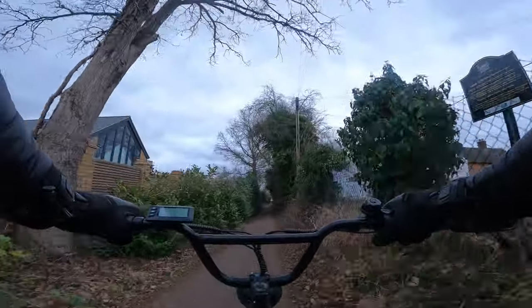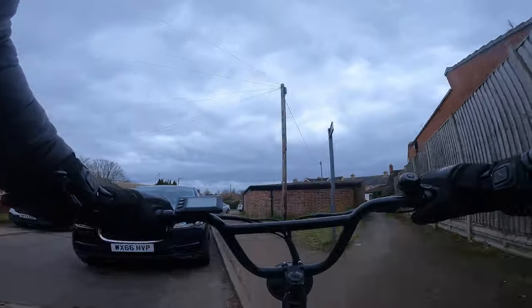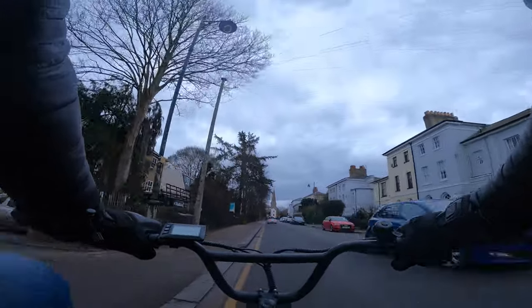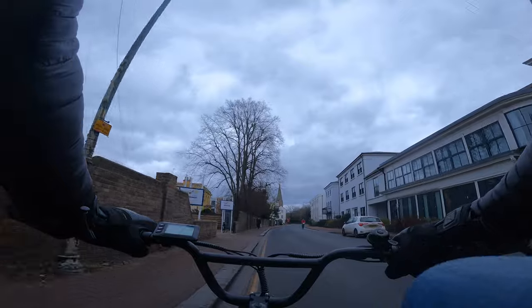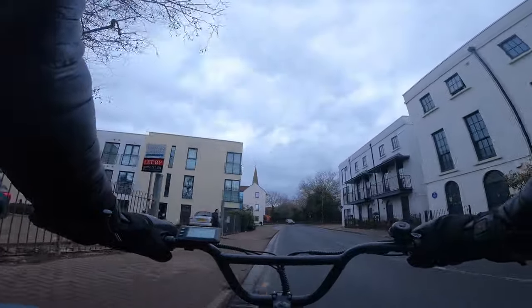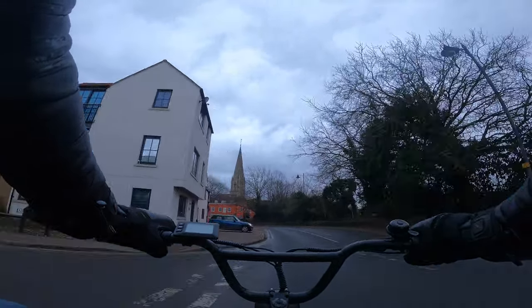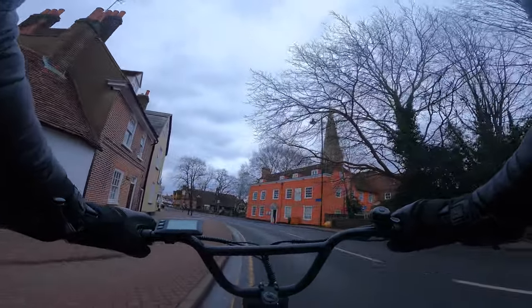Pretty interesting stuff guys. I really like the fact that you've got this kind of very small battery which is quite easy to move around, and you can charge these on normal hobby LiPo chargers — that's quite nice. So 15 and a half miles per hour, 250 watts, absolutely no problem at all. It's a nice comfortable bike. It's a real shame about that battery though. I don't know what on earth actually happened to it — it was a bit flaky from the start. Right at the beginning when I got that battery it seemed like it needed to be bounced back into life. I thought when I plugged the charger in it kind of brought it back to life, but I don't think it was that. And then I thought maybe the BMS has got like a deep sleep feature for storage.